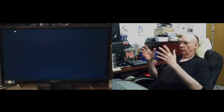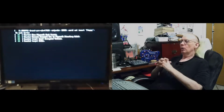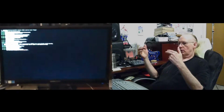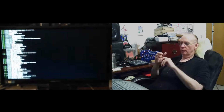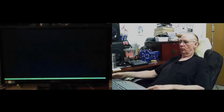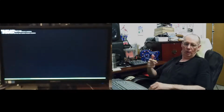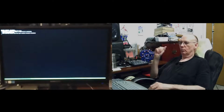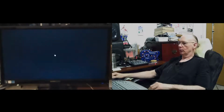I know it works. The installer will boot without any changing to the video or anything, if I remember right. So even though I'm not using it yet, at least I know that it'll work. Okay. So if I do that, I don't have to spend all that time writing it to SD cards and stuff. I can just switch. I can go into the BIOS. I'll reboot it. I'll go into BIOS and make VGA first and the video card second, and then maybe it will.